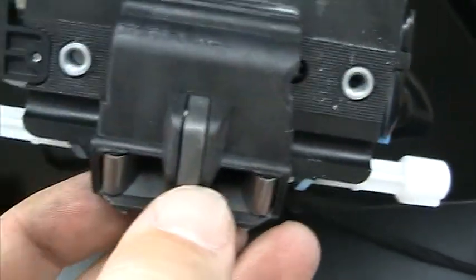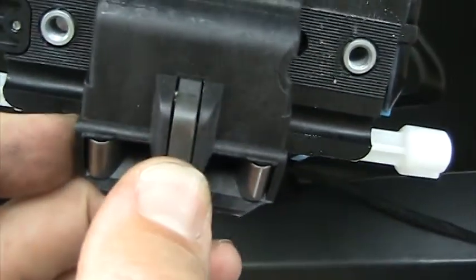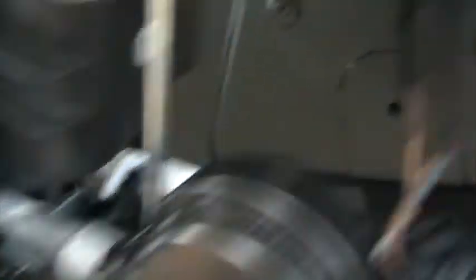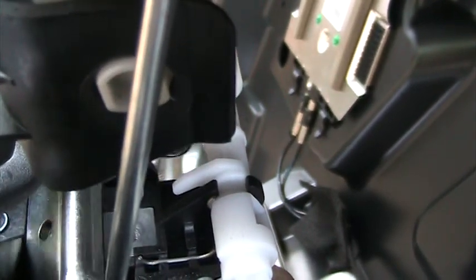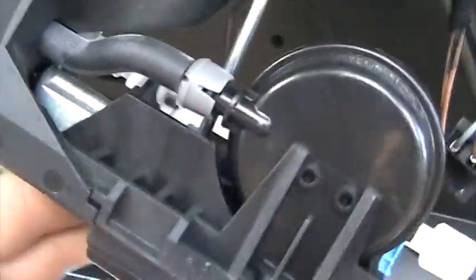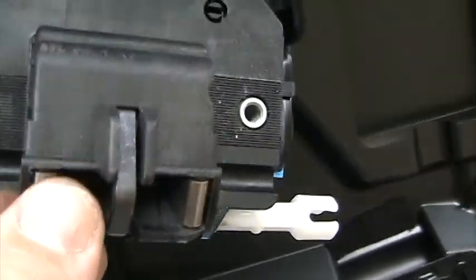We're going to go from one, which is the open condition, and go down one, and then I'll try to flip it over so you can see the actuation. The actuation happens — we'll get it on the release here, hopefully. Because the pump's still running, so it's still fighting it closed. After that delay — after it gives it 15 to 20 seconds of soft close pull — it pulls it down to the second detent.